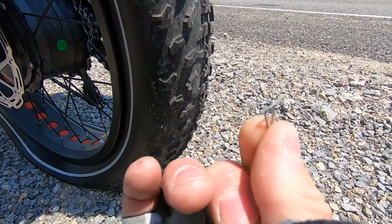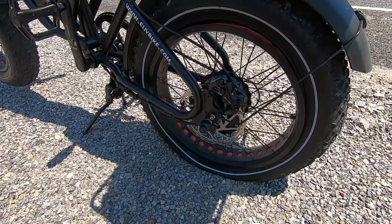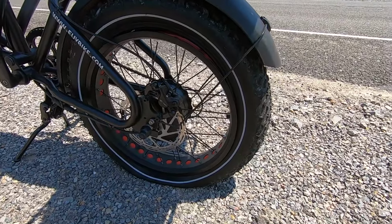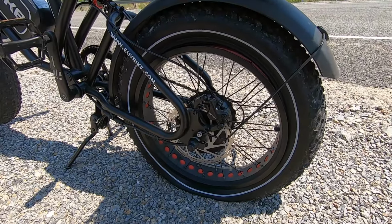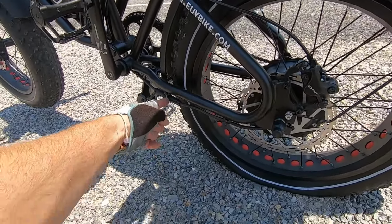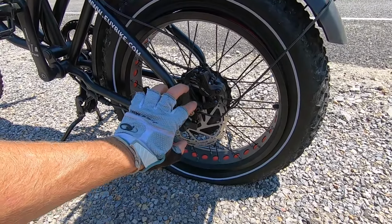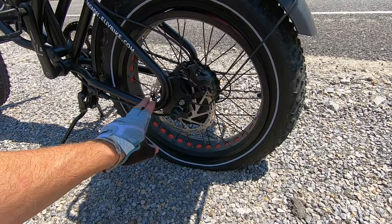Go. That's what happened. Pros and cons of these little e-bikes is the tires are good suspension-y. They're fluffy, but just the slightest stuff will blow them out. Now, obviously, I just found that big spike in the tire, so that's what blew it out. And the other con about this is it's almost impossible to replace the tires on the road because you have to disconnect this and you need actual sockets to replace that. Like, it can be done, but it's a real pain in the butt, especially when you have to disconnect these pieces or those pieces to get the brake off and everything. So I have two of these bikes.